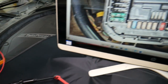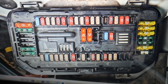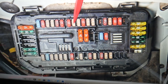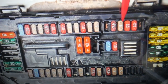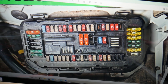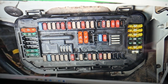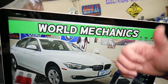Even if you have a missing fuse, count the spot in that row — this is the row towards the windshield side. Starting here, count to find fuse number 24 — that's a very important fuse. Next, you need to find fuse number 32 — that's a 5-amp fuse that will need to be checked as well. After that, check fuse number 54 — that's a 7.5-amp fuse. Finally, there's fuse number 63, which is a 30-amp fuse — that's the main fuse. Hopefully the video is helpful — thank you for watching, see you next time.